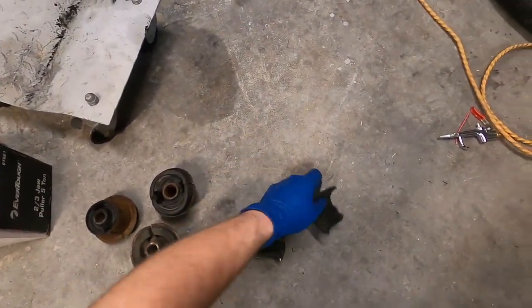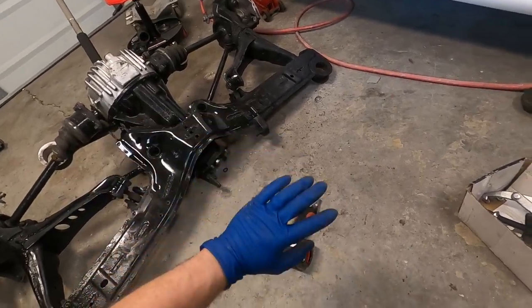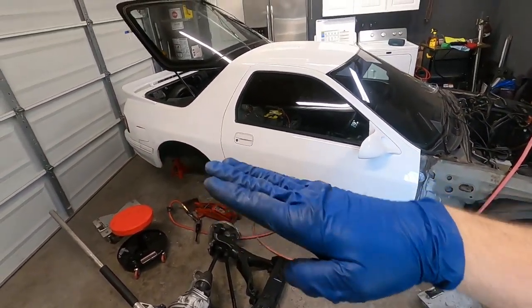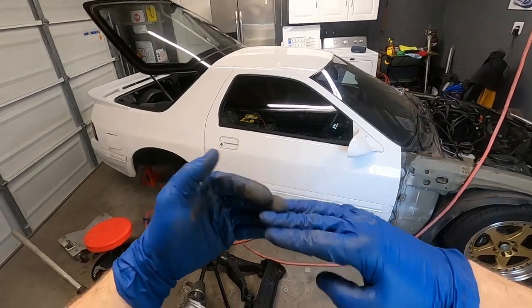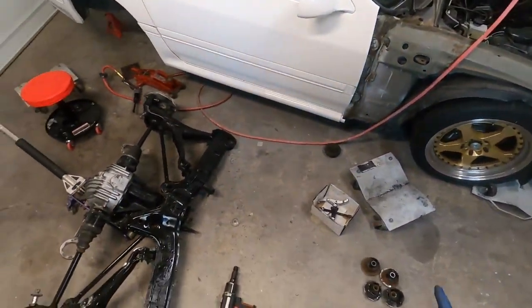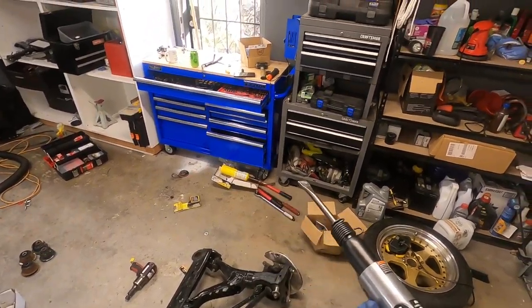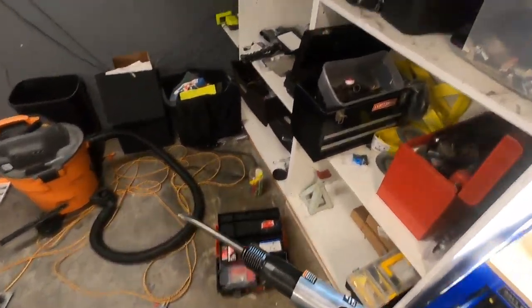Okay great, my ears are ringing and I got all four. These are not in terrible condition, but after this much time and just general age of rubber, it's time to service them. These ones were in much worse condition — these are the diff mounts, which get more flex. I lost the front diff mount, replaced it, but didn't replace these diff bushings, and this one was completely separated. In addition, we're going to be installing the pinion snubber — a rubber bushing piece that we're going to add into the chassis to keep the diff from flexing up as much, so it won't get that play at the joint where the driveshaft comes in. When it gets torque it lifts up and bangs against the floorboards if it's gone, and puts unnecessary torque and delay in power delivery. With the air hammer — 15 bucks at Harbor Freight, comes with this chisel — it worked great. Just be patient with it, put it at the right setting so it's not too powerful, and keep working around and they come out.